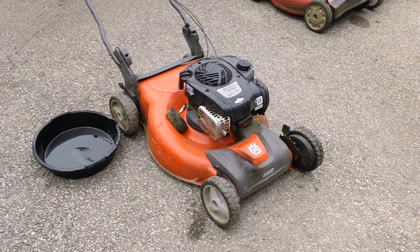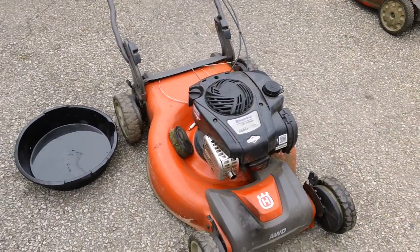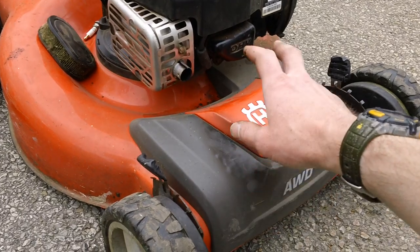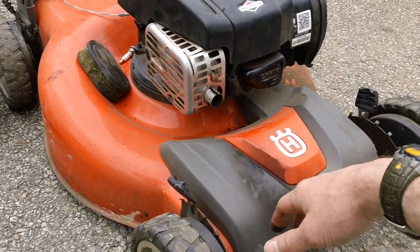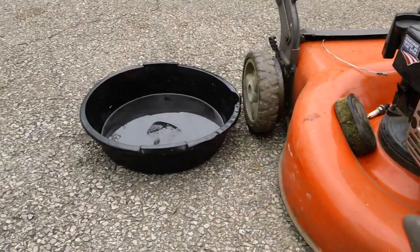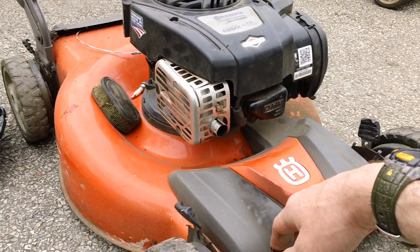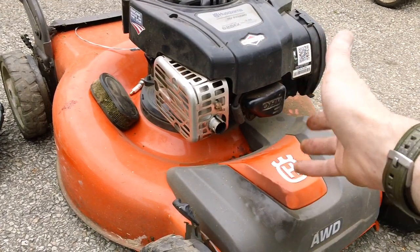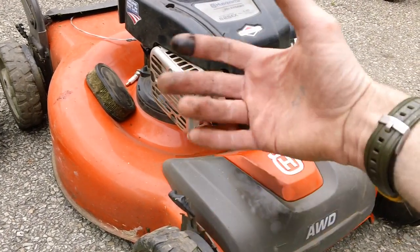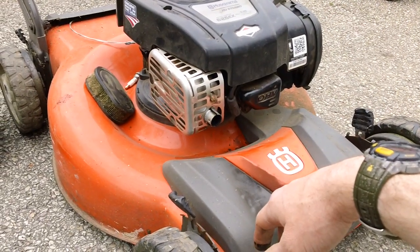So that's everything about why your machine may be causing a hard start situation like this one right here. This guy did not do any kind of maintenance — the air filter was totally plugged, he had tons of carbon coming out of the exhaust. That's one of the biggest things we see with lack of maintenance. Why is my machine blowing black smoke? Well, this is why: no maintenance done to it in five years, air filter totally plugged, spark plug totally black, and oil black as coal. All of that could have been prevented if the customer had simply followed our advice after purchasing the machine back in 2015.